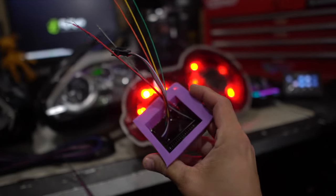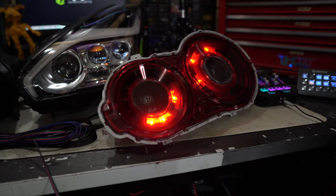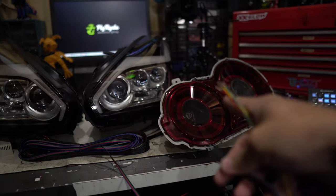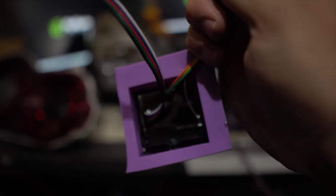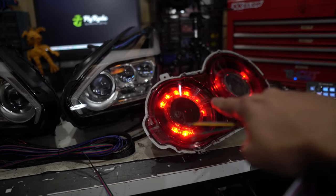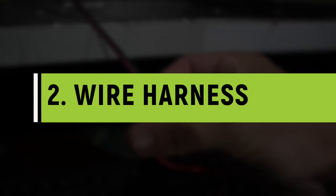Now we can turn them on one by one, kind of like what you're seeing in the background on those newer-style GTR taillights. At the heart of all of this is a ghost sequencer — I've potted this one so it's still in its silicone mold. We can see that we have a certain number of wires; these ones right here are just for programming. I'm going to have to change up the animation simply by accessing the five wires going into the ghost module inside that taillight using the computer. We also have wires for power and ground plus the two show mode inputs.